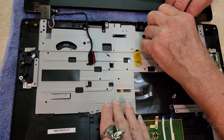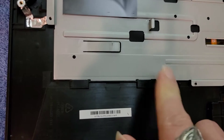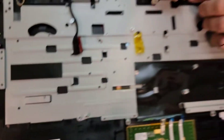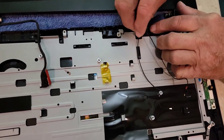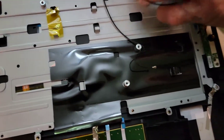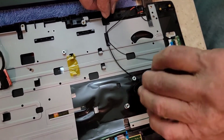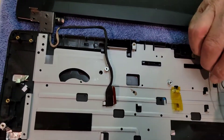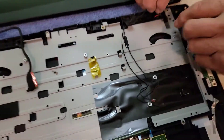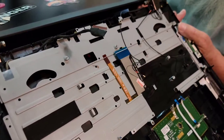Now the next part of the process: we just put this metal plate down. There are clips here and here — this just slots into these little grooves. We had to make sure cables were out of the way and we're doing some re-taping to make sure everything is secure. These go to the wireless card, so you have to make sure two of those cables are free. We got to reattach the hinges and there will be lots of screwing things down again.